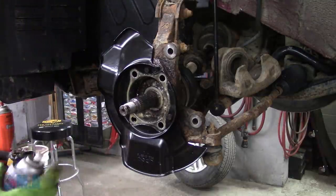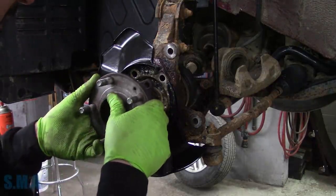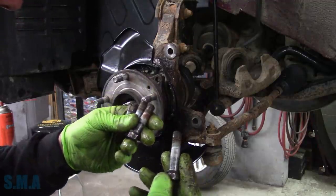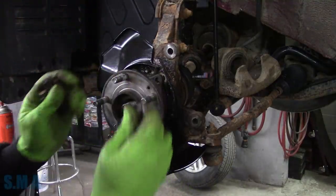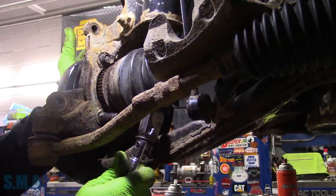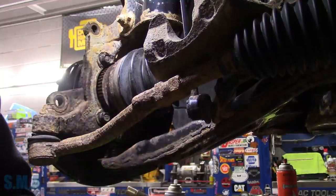I cleaned up the backside of the bearing around its groove so it should slip right in, and I cleaned off the face of it while I had it off. So we're going to give a good spritz down inside there of the fluid film, and we'll get our little Loctite. According to data, it's 72 foot-pounds on the wheel bearing. They had a broad range, like 50-something to 72 - we just go on the high side and make sure she's snug.